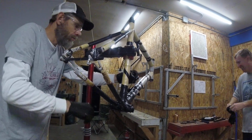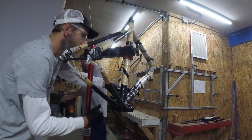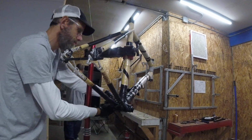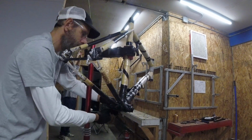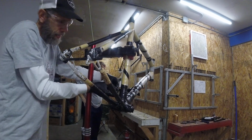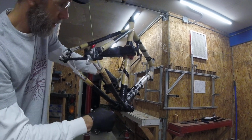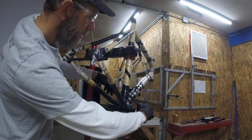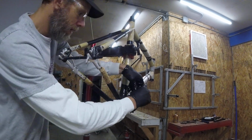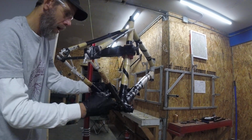So I think you saw me do part of this. It's basically the same thing. You just want to try to make clean passes. But in here, where you're gonna have a hard time fitting that roll, you might have to put some slack in it, stretch it out, and then manage it with your finger. If it wants to go up here, go up here, spiral back down. There's no method to it whatsoever. You're just trying to cover some stuff up. Like I said, don't snake coil it, because that stuff will bunch up. You really want to take smooth passes. Try to get as much as you can. And if you need to change directions, just come off of a tube somewhere up here so you can bend it and put a little more English in it. Alright, cover as much as you can.